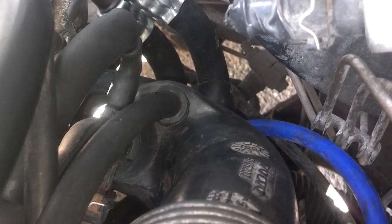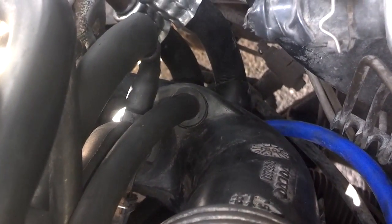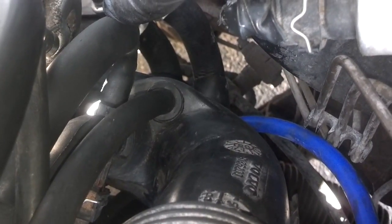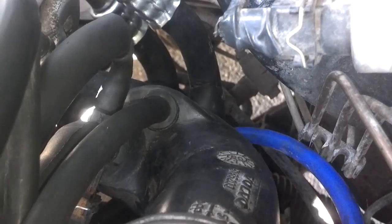It has the PCV hoses hooked up. The one on the right there is the one that comes off of that T from the intake and check valve. Then this one goes to the passenger side of the manifold, and this one goes to the oil trap box. And as you can see, I put a couple of new silicone hoses on this turbo control valve stuff, because that stuff was rotted out.